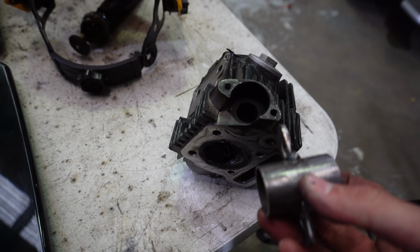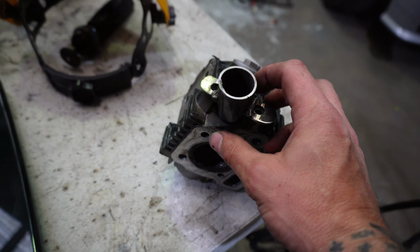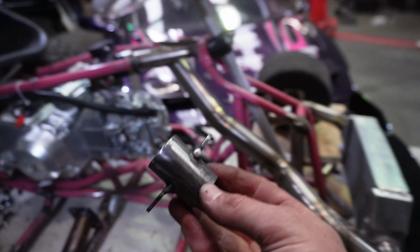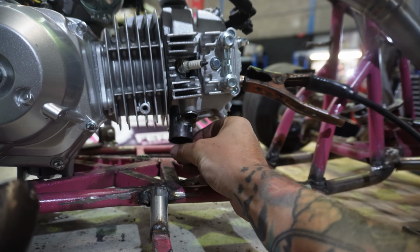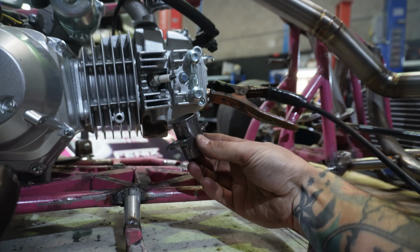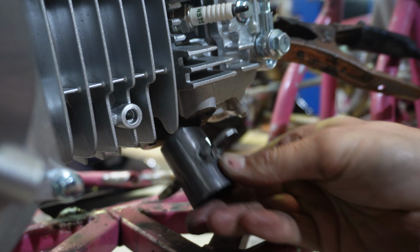Luckily, we've got the old head here. It's actually been really useful because I was able to make a new flange that fits perfectly and it's sealed off really nicely. I know that's sealed now, so we can slip that under here, and that's where we're going to start the turbo manifold effectively, and then we'll weld off this and make sure that this reaches the turbo perfectly. We're utilizing these Allen key head bolts because it makes for way better clearance when we bolt this up.